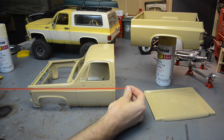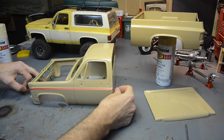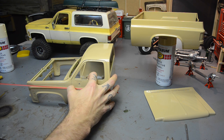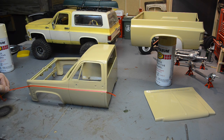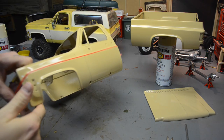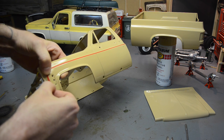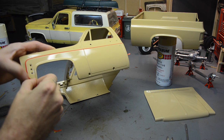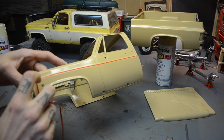It's not perfectly flat, perfectly straight, so you just kind of got to pick where you want to be. I'm going to work the fender — make sure we're where we want to be. The fender kind of curves so you can walk your tape around. This stuff is extremely stretchy, so I kind of hold it, stretch it, and mash it down as I work my way around the curve. Make sure it's seated nice and flat. You've got to kind of act fast because this stuff doesn't like to stay stretched out.